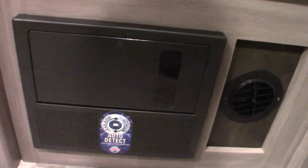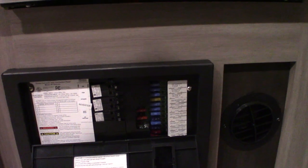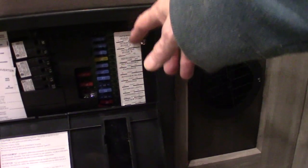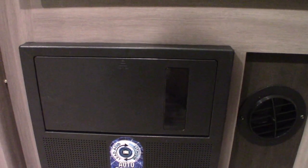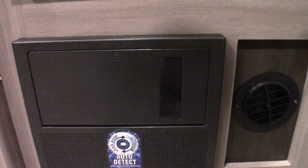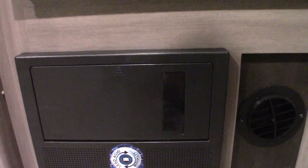This device here is the power converter — this converts AC to DC power. It auto-detects the type of battery you have: you have a regular lead acid deep cycle marine battery. This side is 110 AC and you have regular circuit breakers like you see at home — they are all labeled. Then the power is converted to 12-volt DC on this side, and you've got 12-volt fuses, all labeled. If any of these blow, you can see them glowing through this tinted plastic here. Importantly, as long as you are plugged into shore power, this is a battery tender also — it will sense how much energy your battery needs. If it's topped off, it will just trickle a couple of amps to maintain it; if it's low, it will send 10 amps or whatever it needs to charge it up. It will always keep your battery charged as long as you're plugged in. And when you're pulling down the road, your tow vehicle's alternator will send power through your charging line and keep your battery charged that way also.